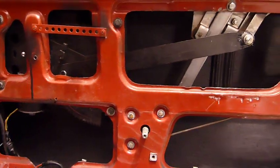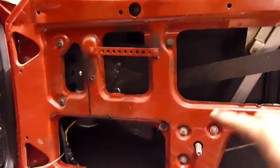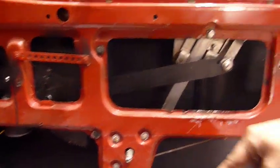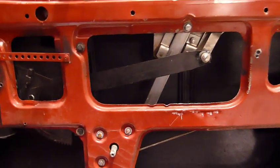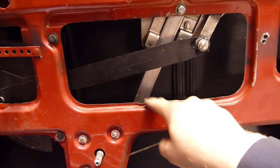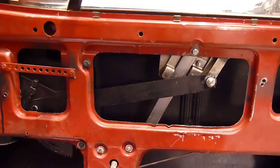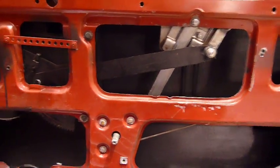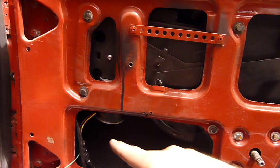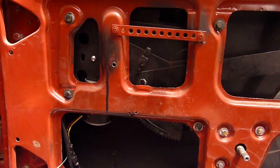After you get that out, you've got some room — and this is actually where the regulator has to come out. If it's pointed up or pointed down, you can't get this thing to wiggle out. It's a real pain in the butt. Someone before me had apparently twisted and bent this in to try to get some room, but the basic fact is this just needs to be straight. I did this conversion — it was fairly simple once I did it. You do have to actually cut the regulator out, so once you do that, you're not going to put the original regulator back in.